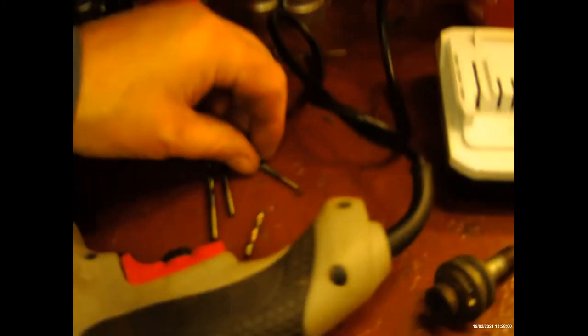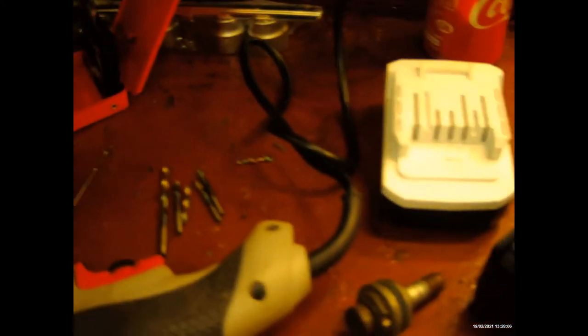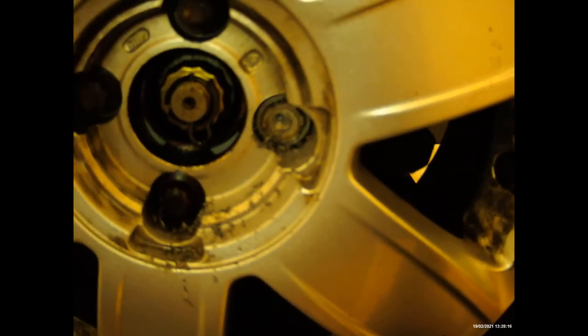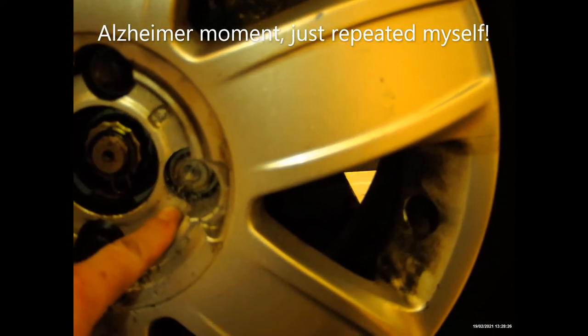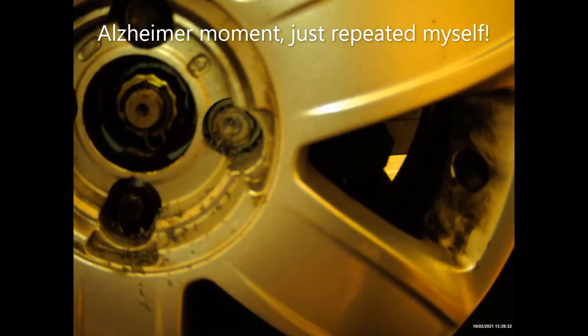It is painstaking, there's a lot of WD-40 being used. But now I'm through with the pilot hole and it's working. I have snapped a couple of bits doing this job, which is frustrating because they are cobalt drill bits. So I've gone through a couple of bits. Hopefully I'll level it off in the next hour or so, and then I can start on the clutch. The reason this is damaged is that people have used an air gun to put this on and take it off, which is why we're now trying to remove it using a drill.